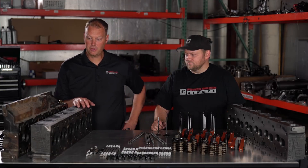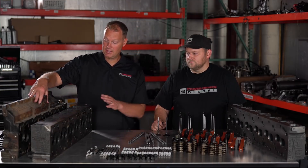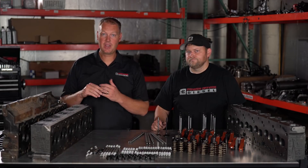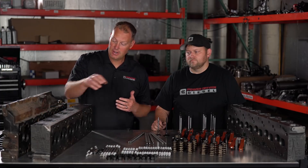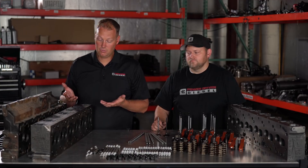Things for a competition build: you'll notice on the stock head there's an intake shelf cast into the head. The Warhead has no intake shelf at all — it's just smooth and flat. So you're going to need some kind of runner or intake shelf. We've drilled and tapped this for an intake-style runner; various companies offer that. It's very easy to install because you don't have to cut off or mill anything — it's really nice that way.